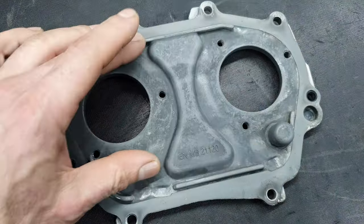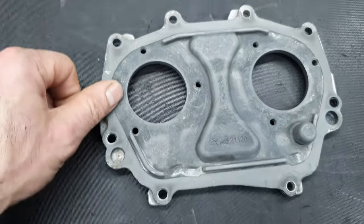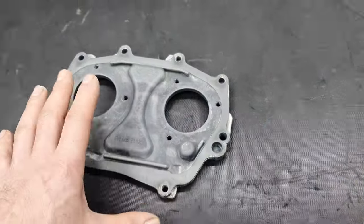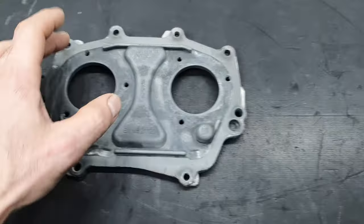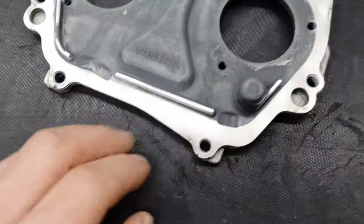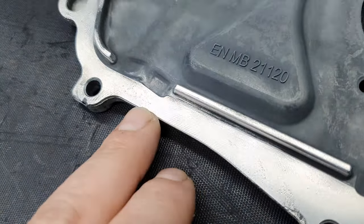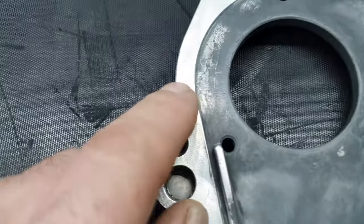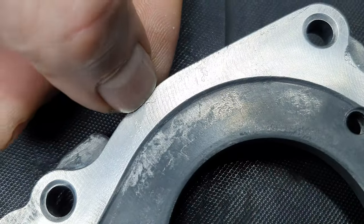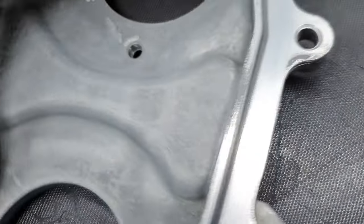Okay, so what can you do for that, right? Obviously, the inner side, you don't have to bother with because it has engine oil. On this side here, what I'm doing, this doesn't mean that you have to do it. This is what I'm doing, okay? I am touching this surface successfully without any problem. And I'm doing this surface like this. And I'm not removing the machining lines. You can still see the machining lines. Okay? You see here, let us say, one imperfection on the magnesium, but you can still see the machining lines all over around.